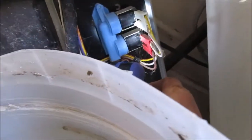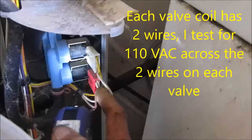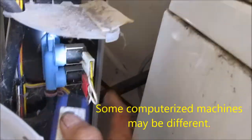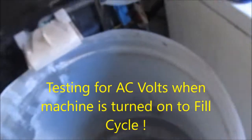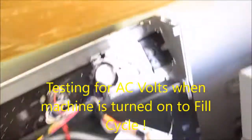When you turn your washing machine on, you should have power — typically 110 volts on one of these two lines. If you have a warm setting on, you should have power to both lines. If you have the cold setting, you'd be on the cold line. Put your meter right here and here, set it on voltage, and when you turn your machine on you should have voltage here.